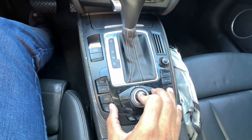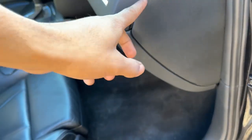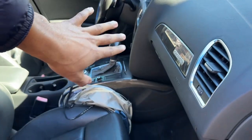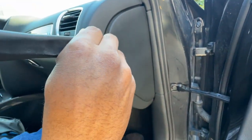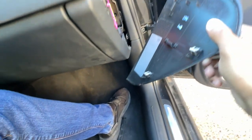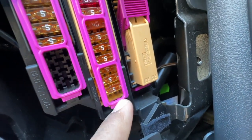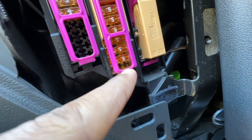So I'm going to check the MMI fuse and see if it's blown. The fuse box is located in the passenger side dash under this panel, which just pops right off with trim tools — there's also another fuse box on the other side for other functions. This is the actual fuse box right here; counting up, position three in the middle is for the MMI.